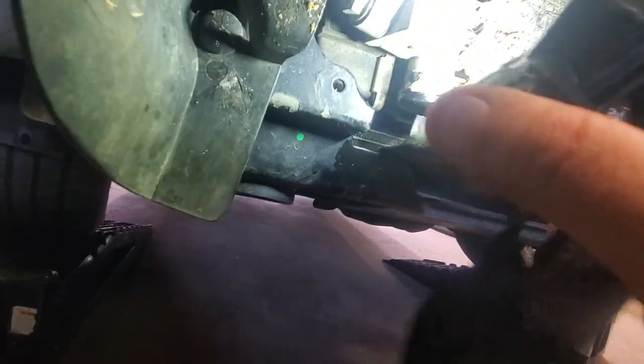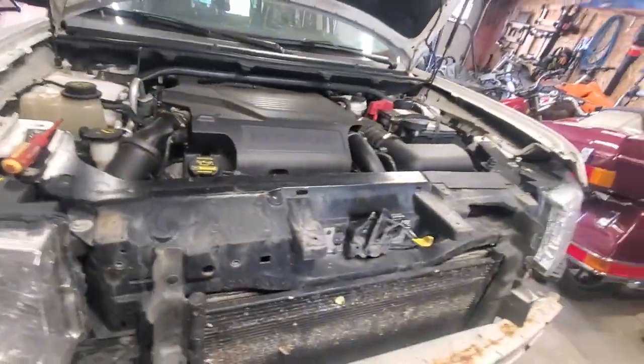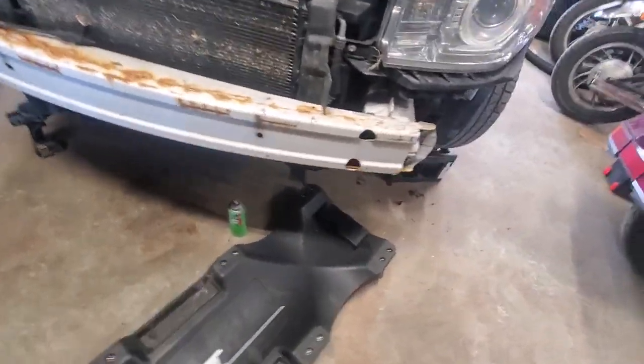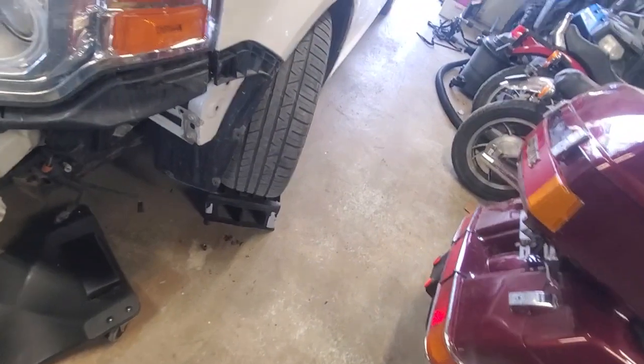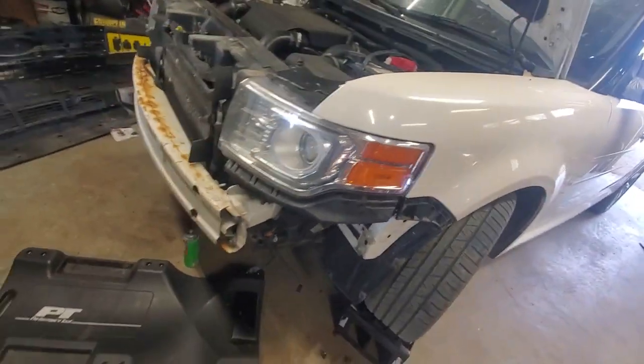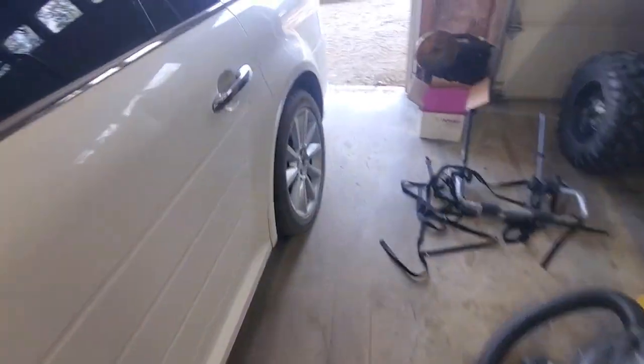If you find you have lots of surging going on at half throttle, it usually clears up when you floor it. Apparently it's a very common problem on these EcoBoosts, especially bad in the F-150s. But I don't think that was my problem — I think I've got something else. This thing had a stuck injector and I think I may have fouled my cats and sensors, so I might have to get into that. But anyway, that's a simple one — hope this video helps somebody. If you have any questions, ask, and as always, may God bless you.